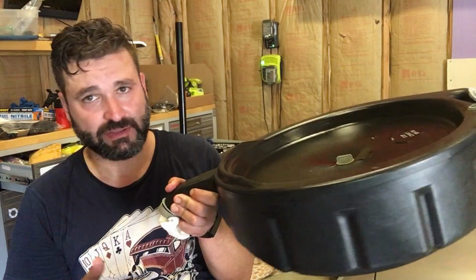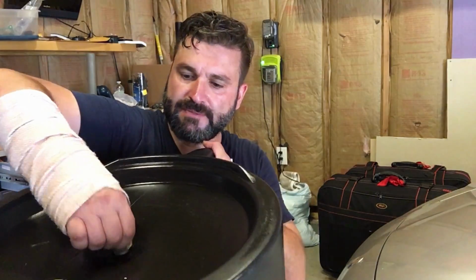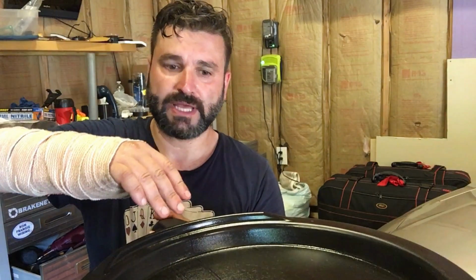Alright guys, so as you could see, it's a pretty simple thing to do. Very hot day today, and I did have a bit of a disaster, but it's the dumbest thing. Basically, I'm gonna tell you so you can learn from my mistakes. If you have an oil catch pan like I did here, what this does is basically you pop it up for the oil to fall inside, which I did, but I did not pop open this little breather. And what happened was the rate of oil falling out of the car into this catch pan was higher than the rate of oil going in inside because I didn't have that breather open, and basically it overflowed and I spilled oil all over the driveway. So, you know, I had to run and get kitty litter and all that stuff to get it soaked up.